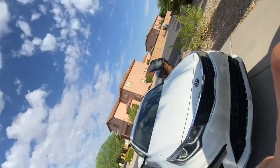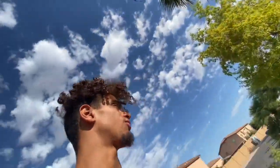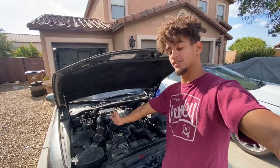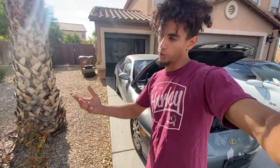This morning we're replacing this other coil pack up here because, as I was explaining in the video of me riding home in it, the exhaust pipe heats up. The symptoms look like a clogged catalytic converter, which in some cases it could be. But it's very well known for these vehicles to have one coil blow out, which makes the engine only run on half of the cylinders — so only four — which causes a lot of heat to go down through the catalytic converters and into the exhaust pipe, making it heat up and turn red.